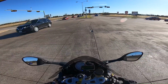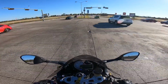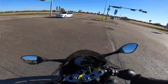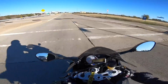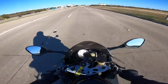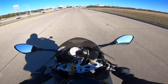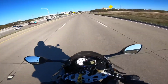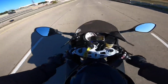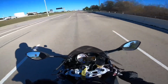I'm doing it very slow, guys, so you can see it. I'm not sure if you really can. I'm just trying to talk through it as I go along. Here we go. So first gear, ready to shift: let off, clutch in, kick up. Boom, just like that. Let off, clutch in, kick up, let back out the clutch. If I want to go one more: let off, clutch in, kick up, let out the clutch slowly, boom. And you kind of hear it, because I'm letting out the clutch too slow with too much gas.